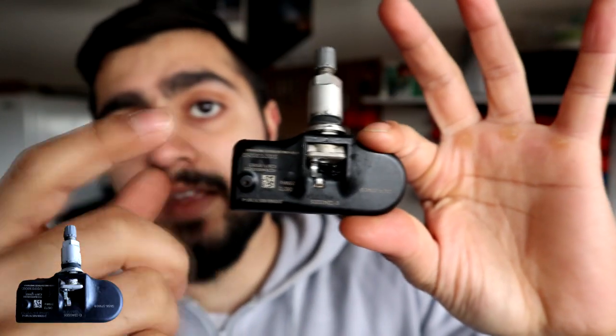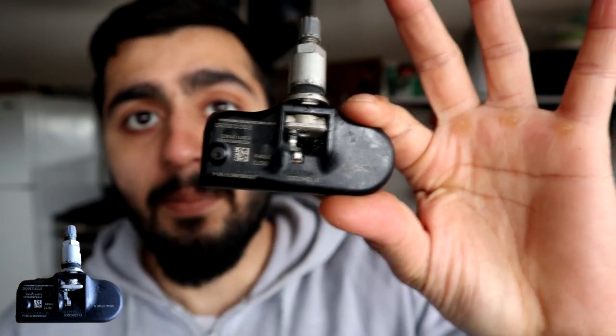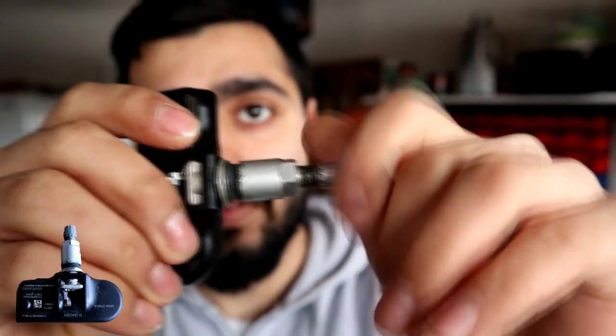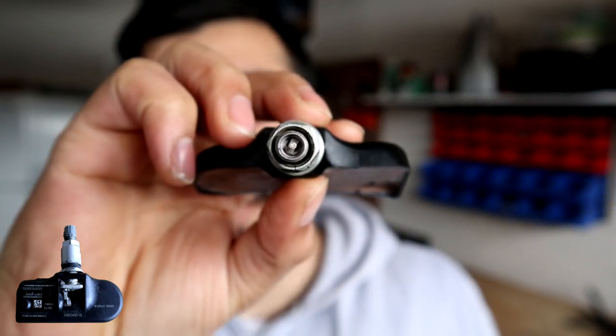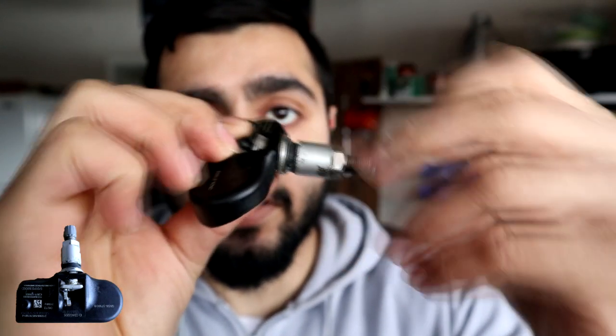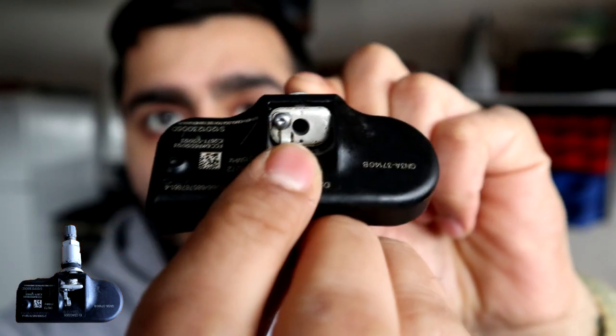As you can see on the bottom of this, we have a sensor attached to it — we're going to call that the tire sensor, because this measures your tire pressures directly. You've got the cap — you take that off and on the inside you still have that same Schrader valve. You can hook up your air tool, it opens up that passage, and the air comes out from this hole at the back — that's how it gets into the tire.